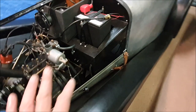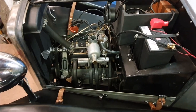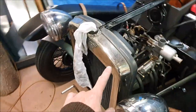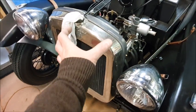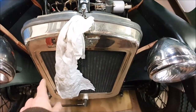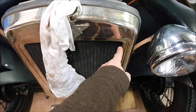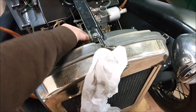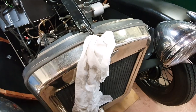The straps are all done. I've taken the bonnet off because I now have time to fix it properly and put it in with the parallel sides. I've also tweaked the radiator grill because I found it was off square — it's always been a little bit off square, I keep adjusting it and it keeps moving back. I found a lot of the bolts were loose, so I've tweaked it and tightened everything up. You can actually see the radiator has a bit of a twist in it as well, which might be why the surround was twisted. You can see there's a gap there but no gap on the other side. You can twist the radiator around and it'll go into position, but it should be fine as long as the surround is square to the car.